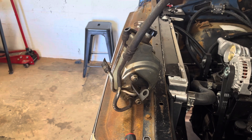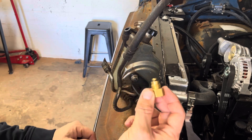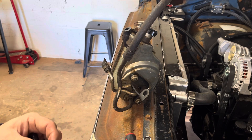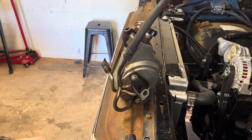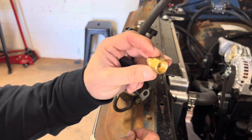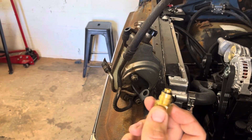I've got this spare power steering pump from an LS. Basically, you probably wouldn't have the pressure line already on here, so there would be an empty port down here — that is where your adapter fitting threads into the pump itself. Then you just hook up your factory replacement power steering hoses on your square body just like you normally would: two of them into the gearbox, cut the return line to length, hook it up, and screw the pressure side into the back of the adapter fitting. It converts the three-eighths flare to the O-ring that the LS style uses.